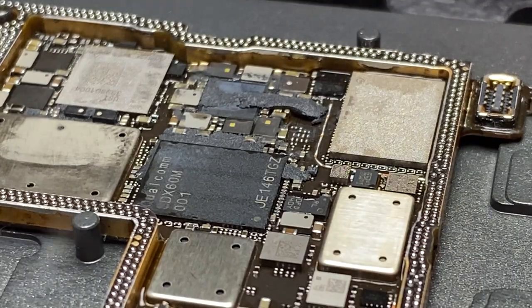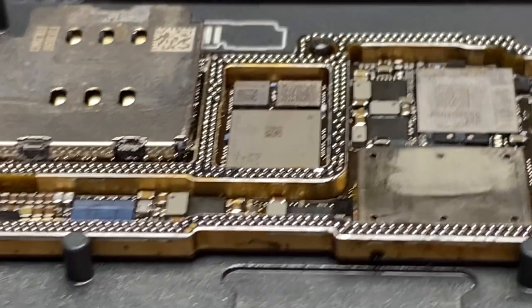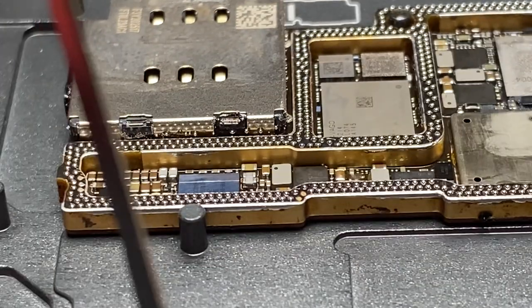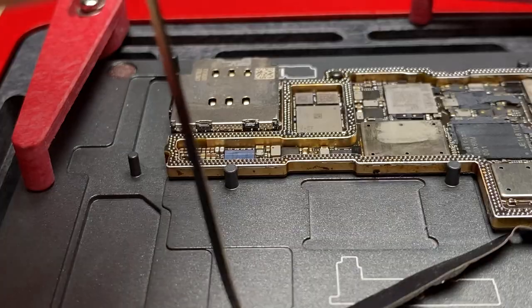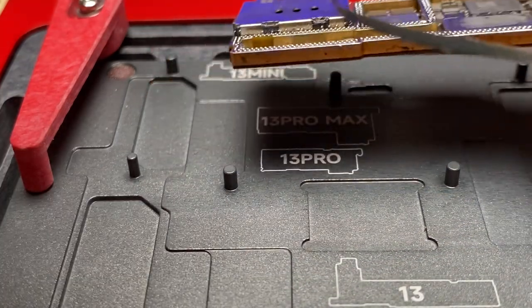Look at that. Pretty instantly, all of them have made it to be fully intact solder balls. Now we'll go ahead and turn it off, and I'm going to carefully lift up on the board, and we'll take it off and let it cool down.